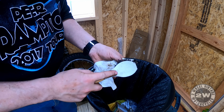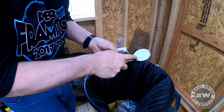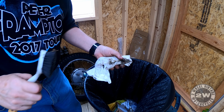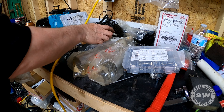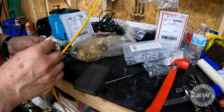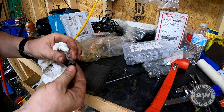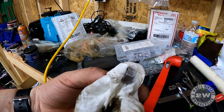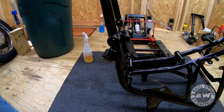This is kind of a time consuming process. When you've got a nut you want to reuse, get some degreaser and scrub it, get all the gunk off first. Then bring it over and start cleaning up the sides of it until you get it to look like something again - better than it was, right? While this is easy to get at, I'm going to put the side stand - kickstand, whatever you want to call it - on it. Greasing up the pivot bolt right now.